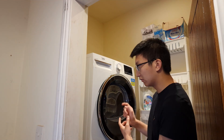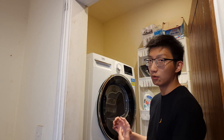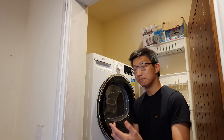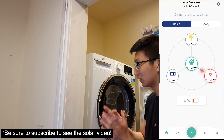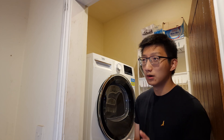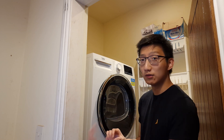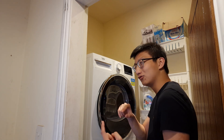This section is about power consumption. My previous heating element tumble dryer used about 2.4 kilowatts of power when the heating element was on — though it cycles on and off during a cycle. My solar array can only output about 3.1 to 3.3 kilowatts, and factoring in the base load of my house — around 500 watts up to a kilowatt — I was pretty much on the cusp of not being able to run it.